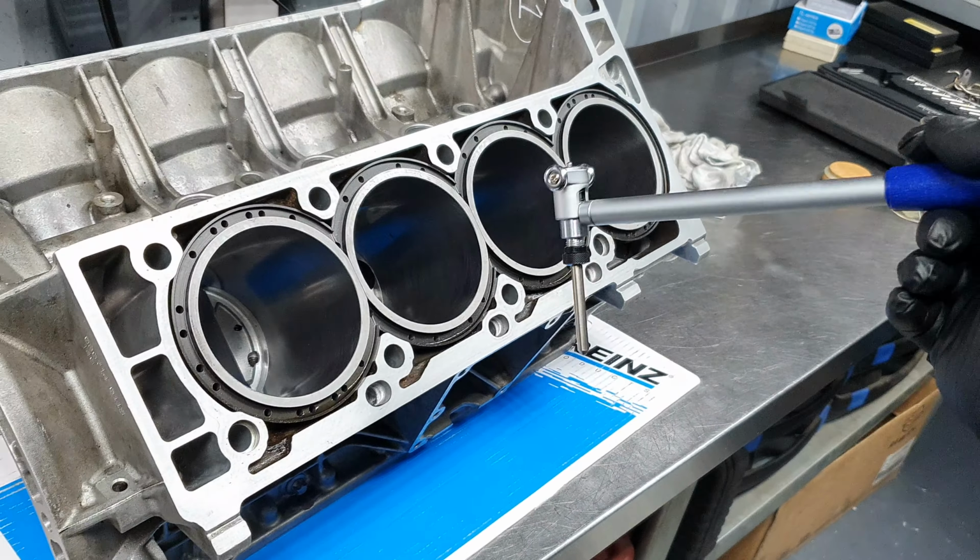So, yeah, that's what I have to say. I hope that you understand. For your pocket, for me, it is what it is. You cannot go wrong if you get pen and paper, if you get the tools. And like I said, you calibrate your tool. You put it here at 98 millimeters. You have a reference, let us say, from another engine that has been measured at the machine shop, and they found the same numbers that I found here, and I'm repeatable.